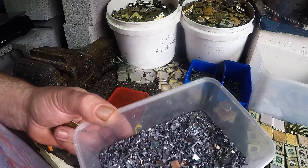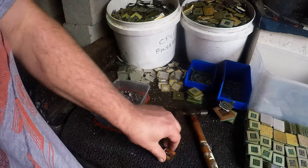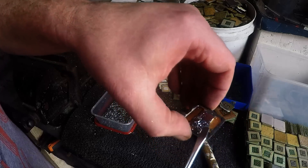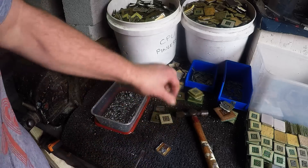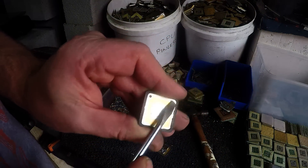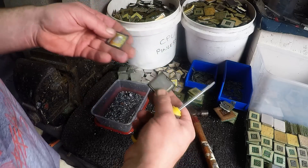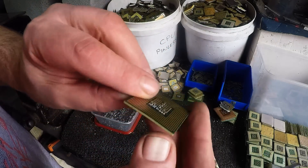So that's what I do with this silicon chip. I just grind it, literally break it up, crush it all up, and throw it in my little tub and clean it all up. So I get something like that - all the silicon's removed. It's sort of glued on so I just skim off that glue, which is like a silvery paste glue. Then I've got myself a clean spreader and the CPU.